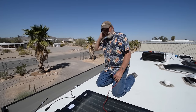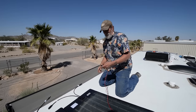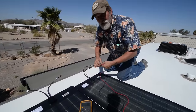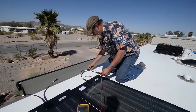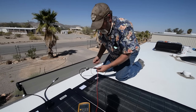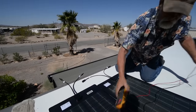While the roof is drying, we'll go over it one more time before we set these. We're going to verify voltage on both of these panels, just to make sure you're not installing something that needs repair. They do get shipped and they do get hurt. There's 21 volts on one, 21 on the other. We've got good panels.